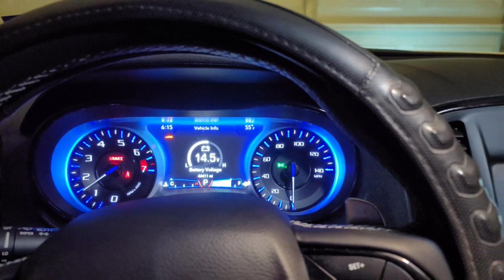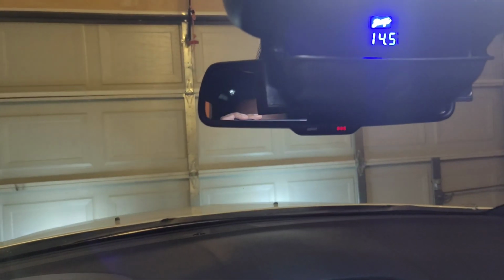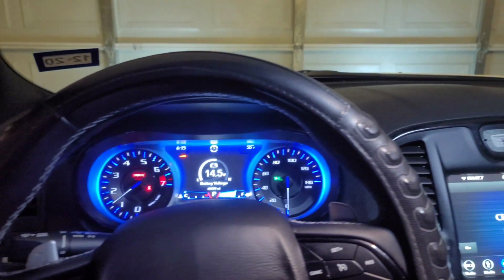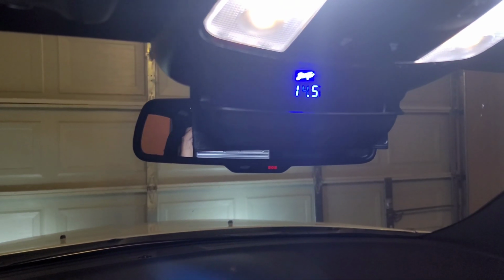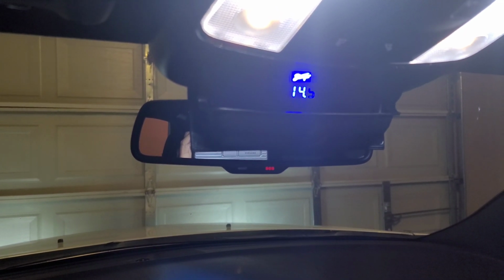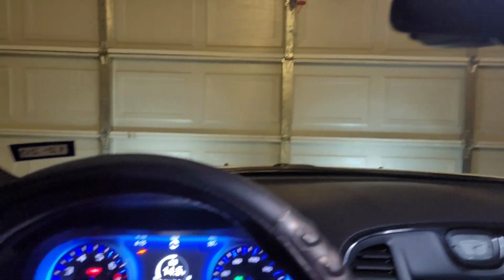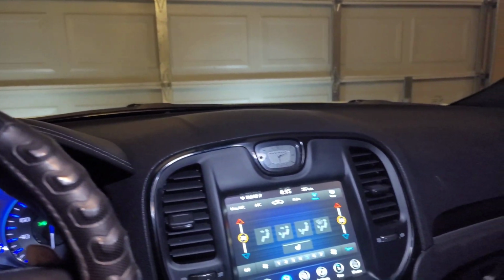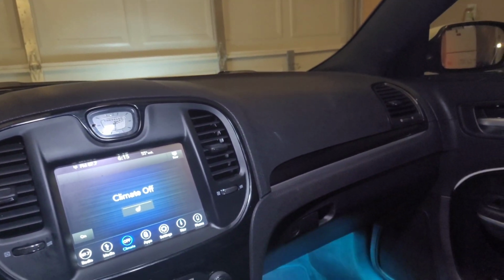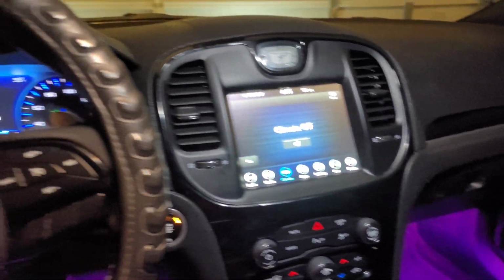14.5 volts in the car itself. Got another voltmeter, 14.5 as well. With the doors open, LED lights on, everything, the heater on, 14.5, 14.6 volts. A lot better. Steady 14.5. So yeah, big 3 upgrade really does work. Of course I knew it would, but yeah, I guess I'll see you guys in the next one.